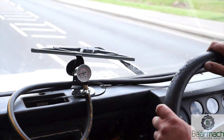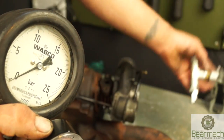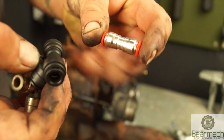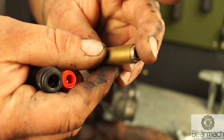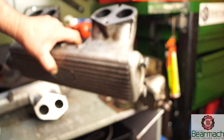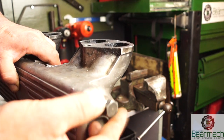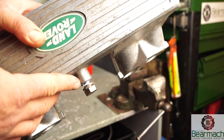The gauge is fixed so you can glance at it while driving — make sure you pay attention to the road more than the gauge. Air fittings on trucks typically use gauges going up to 25 bar, which is excessive here. For cutting into your lines, get a T-piece like this — it's a six millimetre pipe with quick-fit fittings, available in steel or plastic. After testing, if you cut your piping, you'd fit a permanent union. For a comparative test, the 300 TDI has a threaded fitting in the back of the manifold where you can fit a union and run a pipe, giving you absolute manifold pressure rather than just turbo outlet pressure.